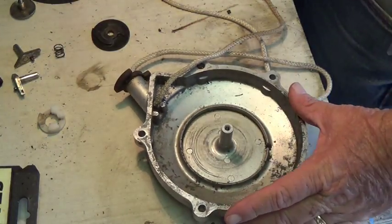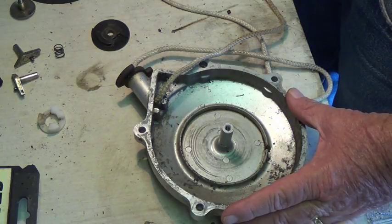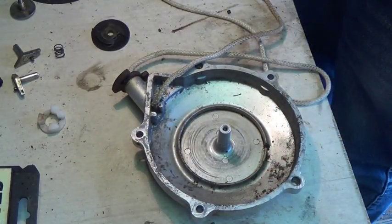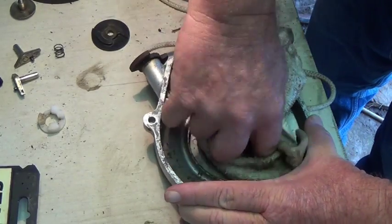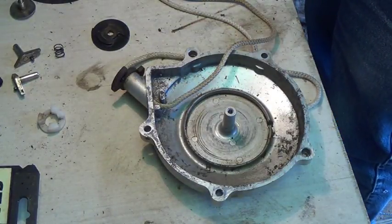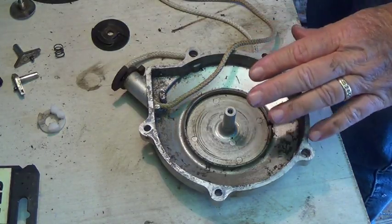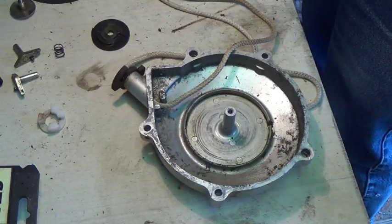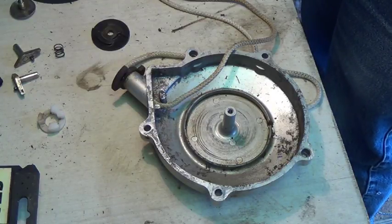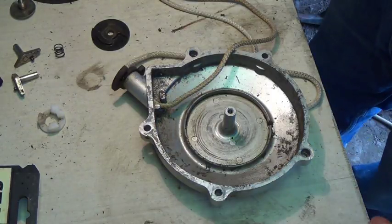Now that we've got this cleaned up, it says clean and inspect - when every part is worn, excessive cracks or damage in any way, replace it as necessary. We've looked this over. It says clean all components, which we did. And inspect the spring and ratchet for wear or damage. Inspect the reel in case of cracks or damage. Inspect the shaft for wear, cracks or damage. Inspect the rope for frays or breaks. Inspect the spiral spring for cracks, crystallization or abnormal bends. Inspect the handle for damage, cracks or deterioration. And if all that's good, then we can go ahead and assemble.